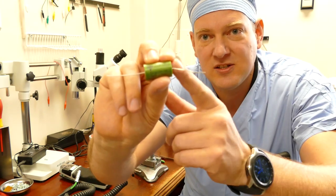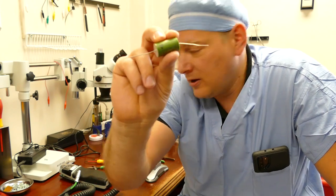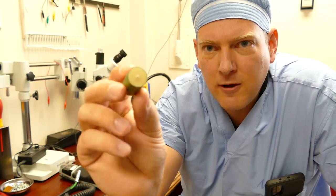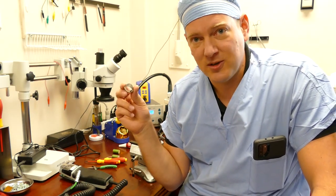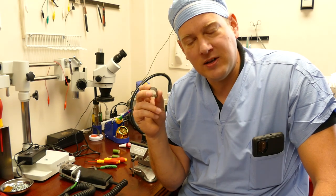This is what breaks on the inside — it'll shear off right at the base of the capacitor. Here's one from a prior repair; you can see how it broke off flush. You also need a piece of three-quarter inch shrink tube. I'm using dual layer shrink tube because it gives the capacitor a little extra cushion, installed over the capacitor body to provide vibration dampening.